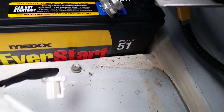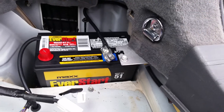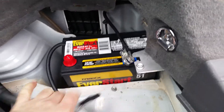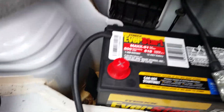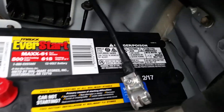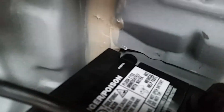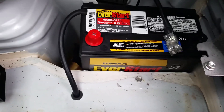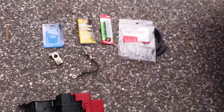The other thing to look for: on the original Toyota battery there's a vent line that comes out the side and goes down into the car. This new battery has two vents, one on each side — I've capped off one of them. The only problem is these vents are different from the original battery, so you have to make that work, and I'll cover all of that now.